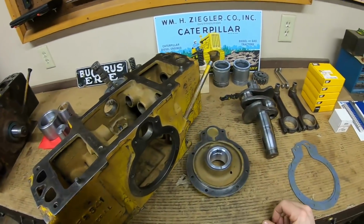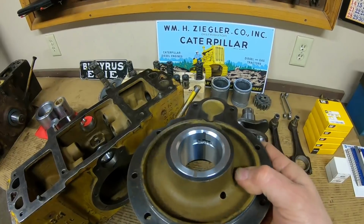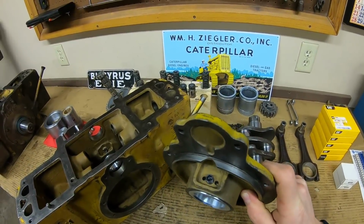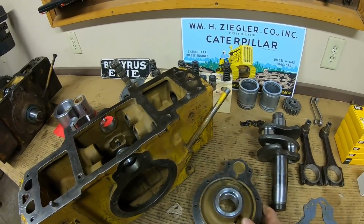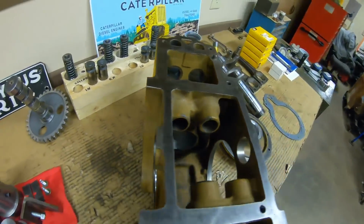All right, everybody, let's find a way to wrap this up. I can tell we're dragging on, but yeah, we've broached the final oil channels in the bearings, and we have the threaded dowel in that one, threaded dowel in this one. I think I can get you up there and see, yep, there's the oil channel in there.